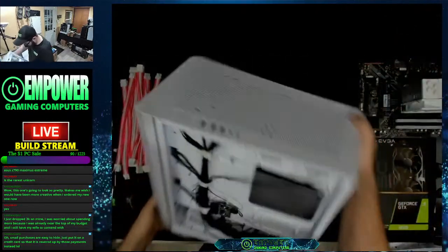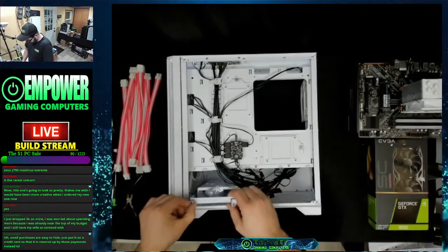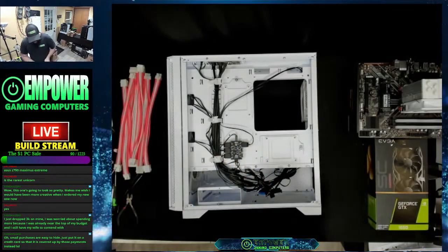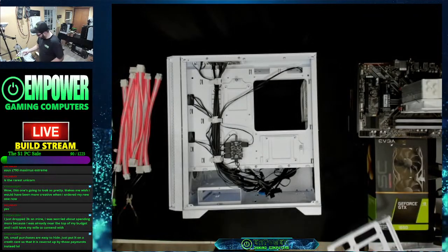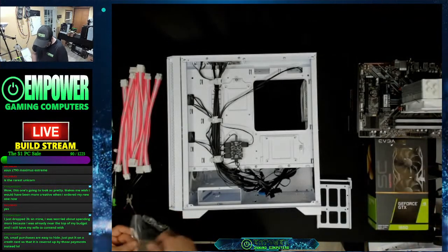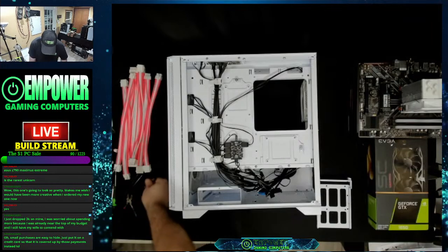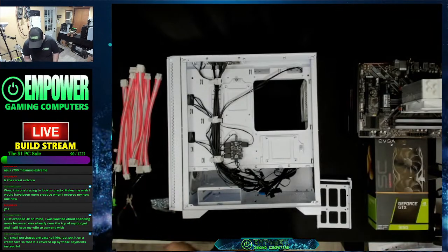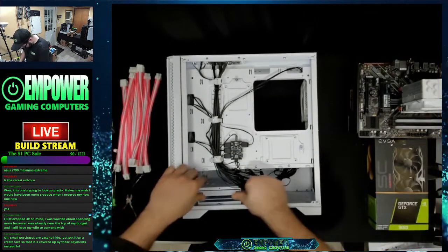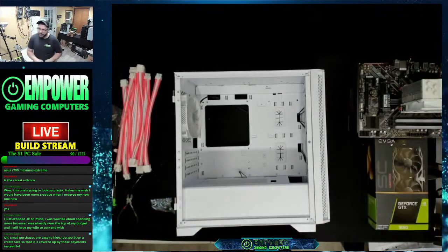We just need to get our screws, our hardware, and it also includes an addressable RGB hub, which does have the reset button plugged into it if we wanted to use that. I might unplug this from the motherboard and plug it into that, so when they push the button, it's actually changing all of it except for the RAM. Just so it's more in sync if they decide that they want to push the button instead of using the software. But of course, I'm going to be recommending to use the software for the RGB. Got our hardware kit. Need to put in our back plate, and then we can mount our motherboard.